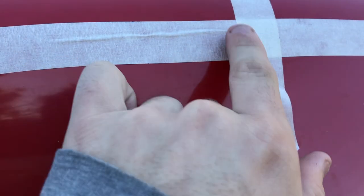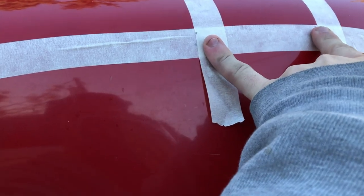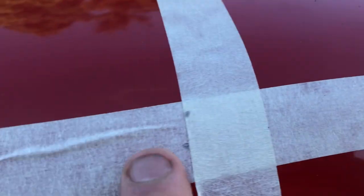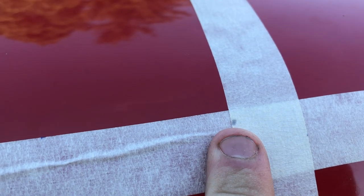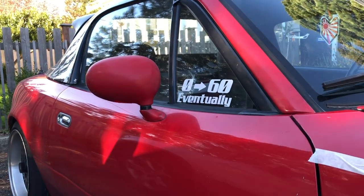This is side two. I estimated a little bit low with this tape when I initially put it on, but this is 23 and a half inches to here, and then I went three and three quarters inches down on either side. That is basically the two drilling points. So I'm going to drill those and then we'll mount both fender mirrors and then take off the stock mirrors.